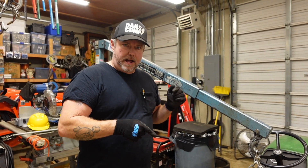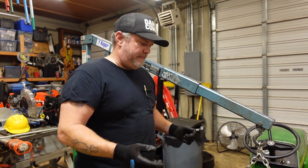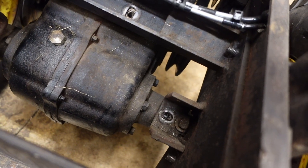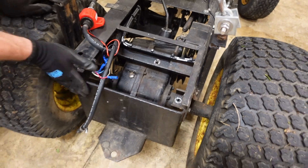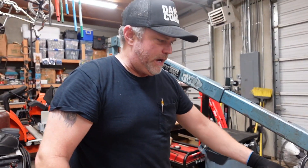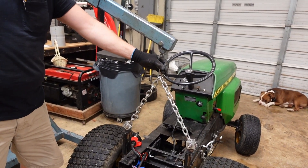We tried to take it out with just the bolts holding it to the frame, and that's not really going to happen. It could if we really struggled, but the bolts are a little bit too close to the side, as you can see right there. Once we take it off like we normally do, we'll take off the six bolts that hold this whole subframe assembly to the frame, drop the tires, and do it that way. It's a lot easier, and we've got this thing supported so it'll be even easier.